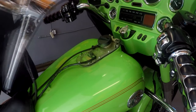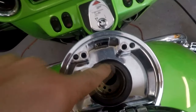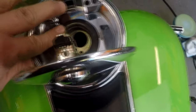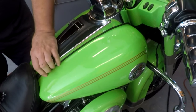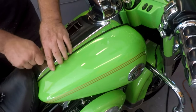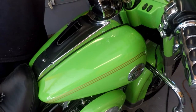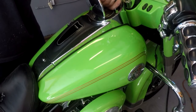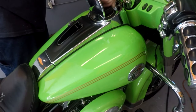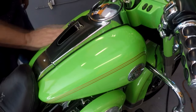Now to put the cover back on. The tricky part here is getting this gasket around the filler neck while keeping it from popping out. Put the screw starters in — one down here, one up top — and tighten all the screws down. Just hand-snug everything, and last but not least put the gas cap back on. She's done — now I've got to clean this thing up.